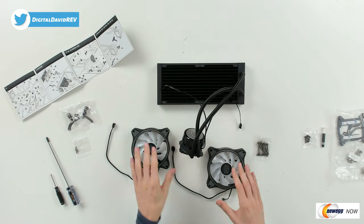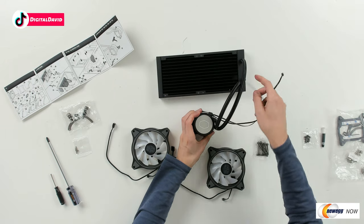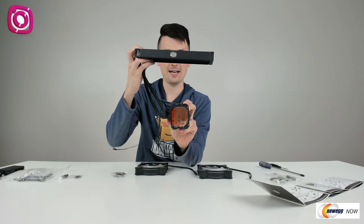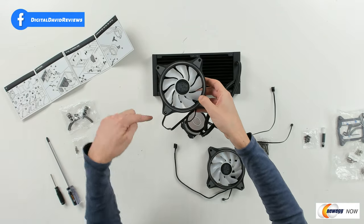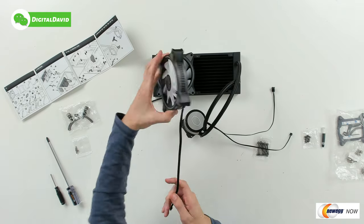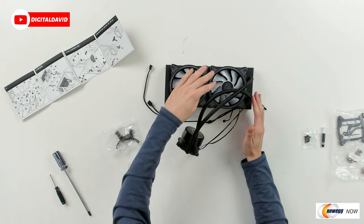So for the cooler, the first thing we're going to do is install the fans. Pay attention to how everything's going to be laid out with your build. So for me, what I envision is it's going to look just like this on our CPU. So these lines are going to be on this side, routed out and through to the backside of the case. This will be mounted to the top of the case and this will be on our CPU. So with that layout, we want to make sure our fan wires are going to be pointed that direction too. You're going to take your fan with the Cooler Master logo and branding — that's going to be face down — and I want our cables to come out and down and around right here. So we're going to drop both of our fans in place, line up the holes, and then take four of these per fan, drop them in place and tighten them down. We got both fans successfully installed.